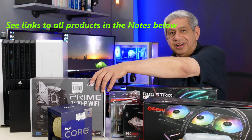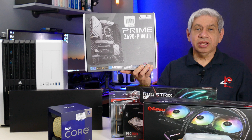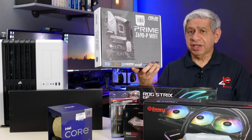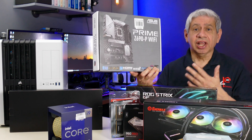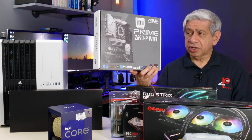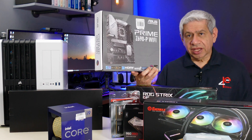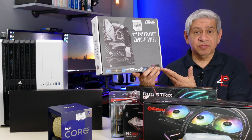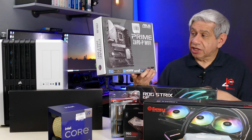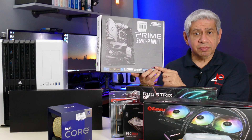The motherboard I chose is the ASUS Prime Z690P Wi-Fi. The main reason I got this is it was a reasonable cost. I don't need the fancy bells and whistles for overclocking, although I do plan to do some overclocking on this system — maybe not initially, but ultimately — and this board does support that. It just doesn't have all the features a true overclocker would want. What it does have that some more expensive boards don't is three PCIe slots that can all support times four. Actually it has four, but only three I'll be able to use, because the first two are too close together and the video card will block one of them.